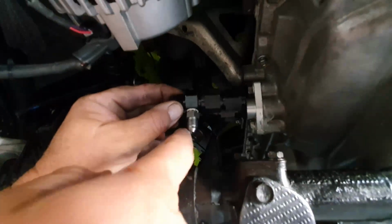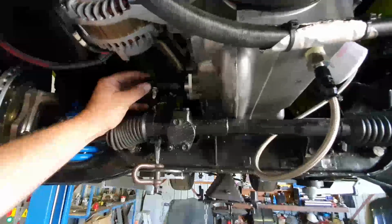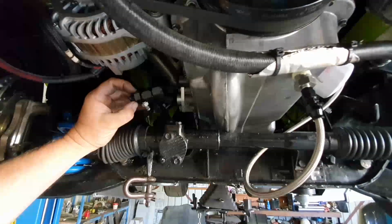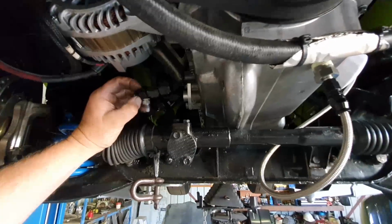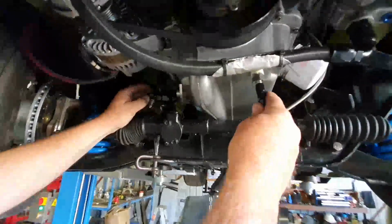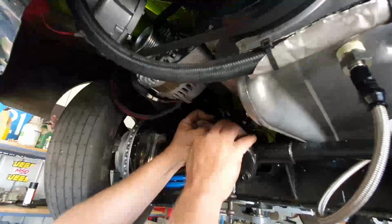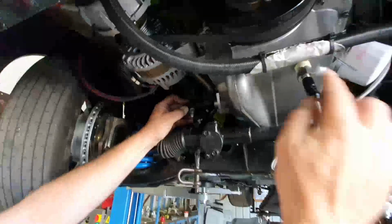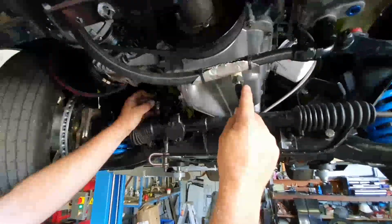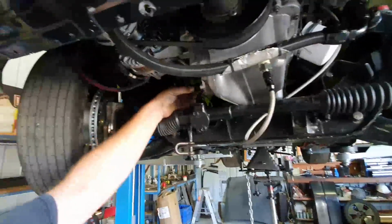So that line would come in and pump the extra oil, which was also coming out of the oil drain, back into the sump. As we love to spend copious amounts of money on Aeroflow fittings, we just buy stuff and then we change it. And so now we're a little worried that the oil pouring back into this was actually blocking the drain. So we've now tapped it into the sump. So that extra oil that's not going to the turbo now goes straight into the sump, and it's keeping that oil drain a lot clearer.